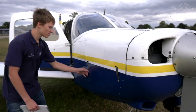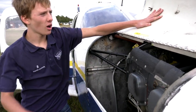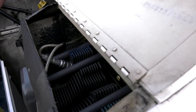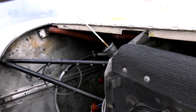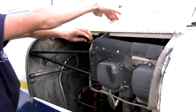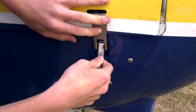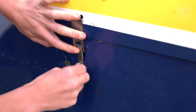Now open the engine cowling by twisting and pulling out the fasteners on both sides, then lift the cowling up — hold it against the wind. Check there's no oil pooled at the bottom, all screws are in, and the magnetos are secured. Check the oil filler cap by twisting it open and checking the oil level is sufficient — in this case it's just under six, which is fine to fly with. When tightening the cap, don't overtighten it as it's hard to undo when the engine is hot. When refitting the cowling, ensure the small hooks go underneath the corresponding hooks on the cowling, then twist and lock each fastener back in.